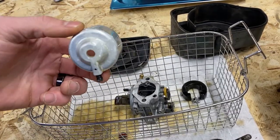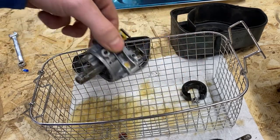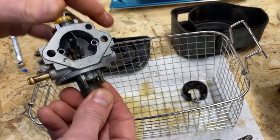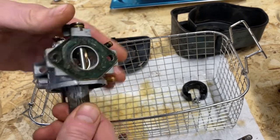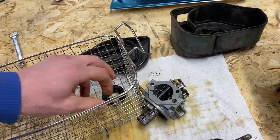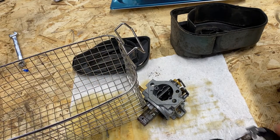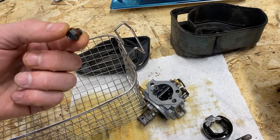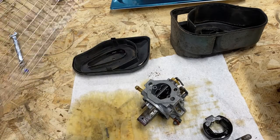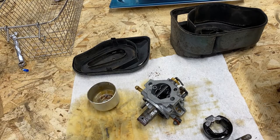Man, look at that — that is shiny like brand new. The big test — look at that, it got all that rust off. I might wipe a little bit, but I'd say that's a win right there. That looks like a brand new carburetor. So I'm going to go ahead and strap this back together and strap it back on the old John Deere and see how she runs. To sum it up, soaking it in Evapo-Rust is the way to go. Sorry Steve's Small Engine Saloon — your peanut butter jar method kind of sucks. Definitely go with the Evapo-Rust.